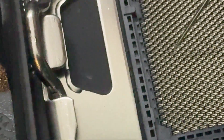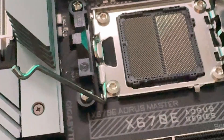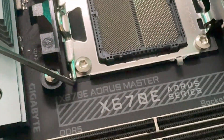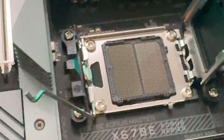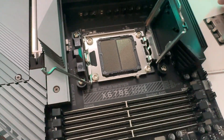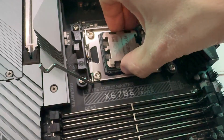Look around the CPU from different angles — there shouldn't be any pins reflected in different directions. You should be able to pan all the way around and it should all look pretty uniform, with no bits sticking out.